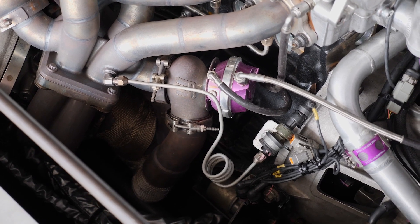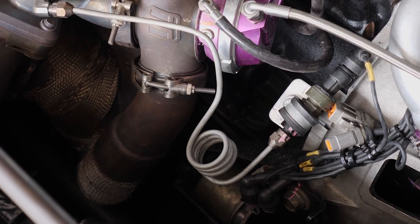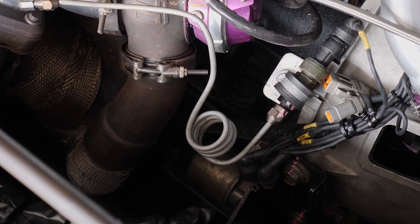Typically when we do this, we'll also add some coils into that section of tubing. This just adds a little bit of additional length which helps dissipate the heat of the exhaust gas before it reaches the sensor. Once we've got that data, we can then run this into our ECU or data logger and make use of the data with sizing our turbocharger.